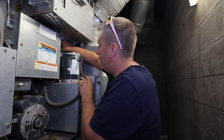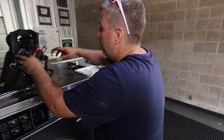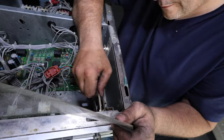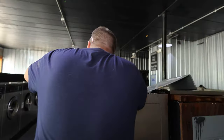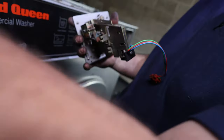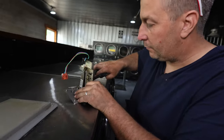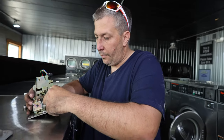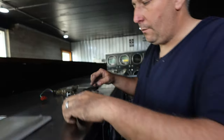We're just putting a bolt on the back for now, then we'll attach the belt and it'll be ready to go. While I'm here, might as well take a look at why this one doesn't take coins. Careful — roaches might pop out. Just gotta take this off and open up that coin mechanism and see what she's doing. It's broke. What happens is when quarters get stuck and don't come back right away, people start beating on it. See that broken metal? That's the top of this busted. What I do is save old coin mechanisms from machines I'm getting rid of — so this repair that could cost $400 to $500 for the part, I can reuse the piece and save myself three or four hundred dollars, not even counting labor.